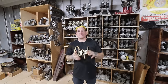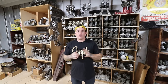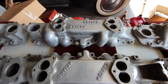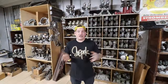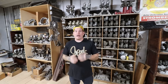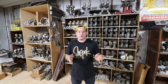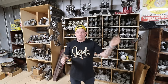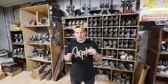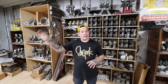From my experience, what you'll find most commonly is an intake set up for two two-barrel carburetors - a 2-2 intake. That intake will pretty much cover almost everyone, especially those driving on the street. You can get away with two Stromberg or Holley two-barrel carburetors. Everything from a stock engine all the way up to a full race flathead can pretty much get away with a 2-2 intake if you set your carburetion up correctly. The nice thing about a 2-2 intake is it's the most simple, most of them are fairly low-rise, and on a lot of these 2-2s you can put a generator in the stock location.